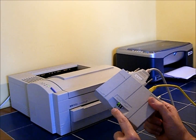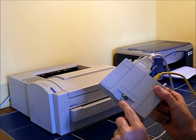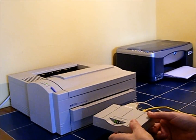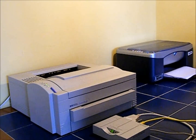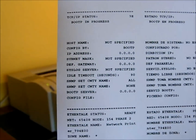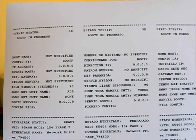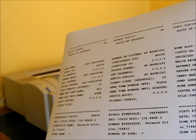In order to look at the initial setup of the JetDirect, there's a test button on the front here which I'm going to press, and you should see fairly quickly that you get a light flashing on the attached printer that will give us a printout of the basic settings of the JetDirect as it starts out. This is the printout the printer has just provided, and you can see there is no IP address set — the IP address is 0.0.0.0, the subnet mask is not specified, and the default gateway is not specified. That's basically because the print server is in its clean state with nothing set up on it.